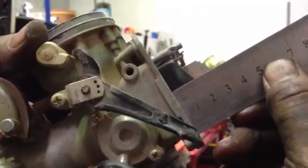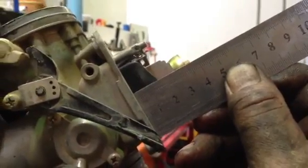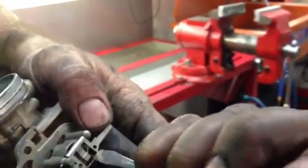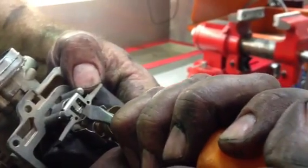Go from flat to doing that — I'm now on about 16. Alright, so that shows what you need to do and you're aiming for 18. So I've just gone a little bit far. So again, hold onto your float, bend it back down a bit. So you don't bend the whole thing, bend it down a touch.